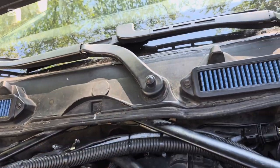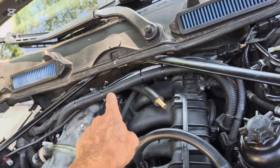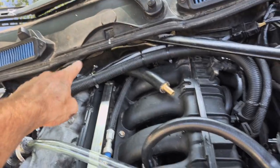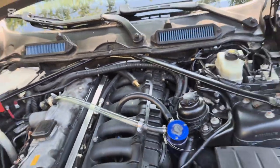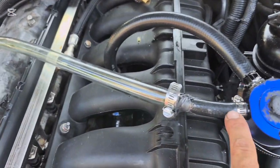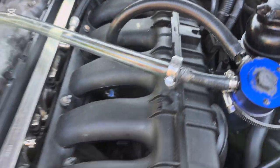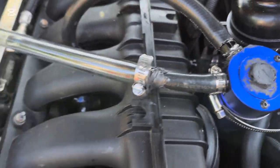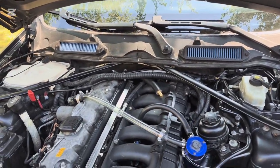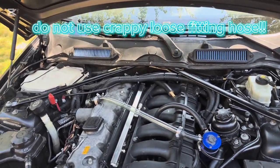So you're gonna get your hose from there going to here, then you're gonna get your adapter piece to go in your catch can, because your catch can fitting is gonna be much smaller than that. This is my old inline, and you can see I had it butchered — this is why I'm changing everything to nice proper fittings because this looks terrible. All this gunk is because of the vacuum leak. Do not do what I did, okay?